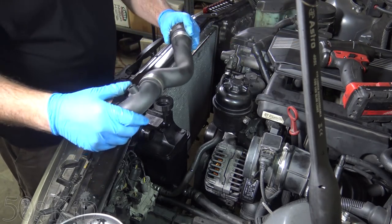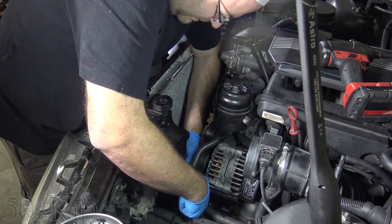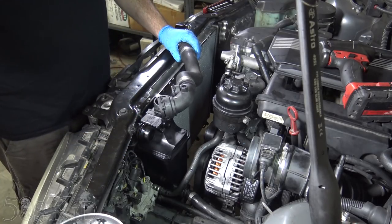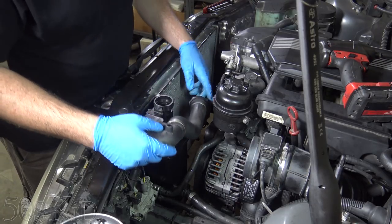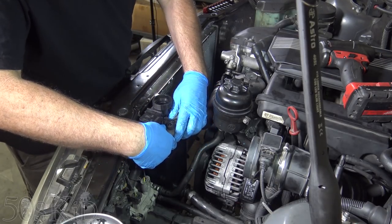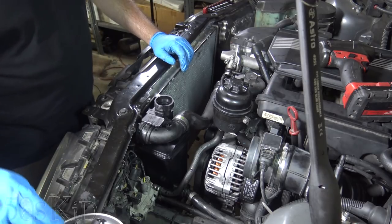Make sure all of our snaps are in place. The snap on this bottom one is in place — pops right on. If yours are really old and you're reusing them, you really shouldn't be — get new hoses if you don't have them. Put silicone paste around them as well; that'll help lubricate those old ones. That one's on. Push that one on and then remember to push the reservoir forward so that it locks into the hose.